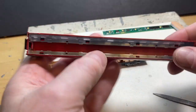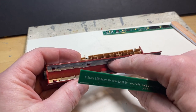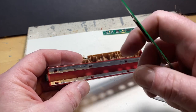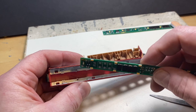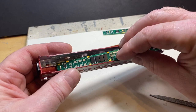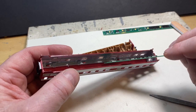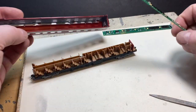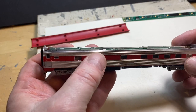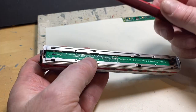Some of these cars — and this is one — have a roof that snaps off, and that's pushing this platform where we have to put the board a little bit proud of the ceiling. We usually double-stick it to the ceiling, but in this car we don't have that option. We'll probably use double stick tape in the middle to hold it, but we can't push it further. That's about a millimeter's worth of plastic pushing the board down and giving us a little more work.